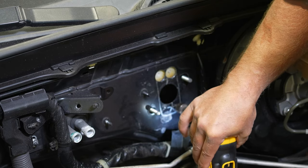All right, so first step on this, we're gonna get the bleeder line hooked up. So dash four, nothing out of the ordinary here. We're just gonna get it started, bringing it in about hand tight, and then usually about a quarter turn with a wrench, we'll get it where it needs to be. Get it snug. Then we're gonna move on to mounting it.